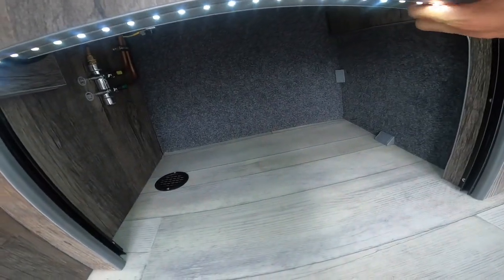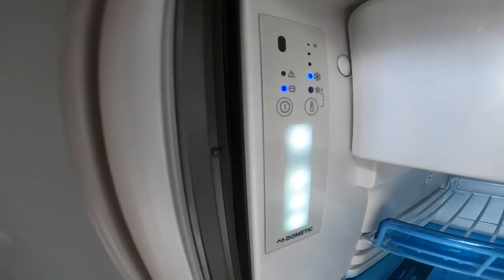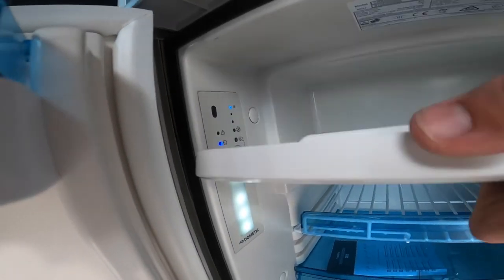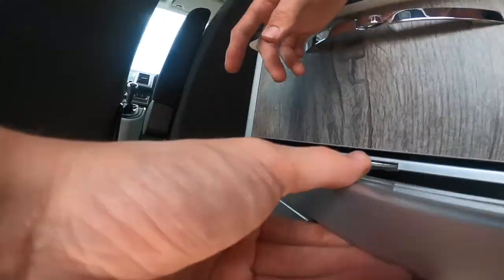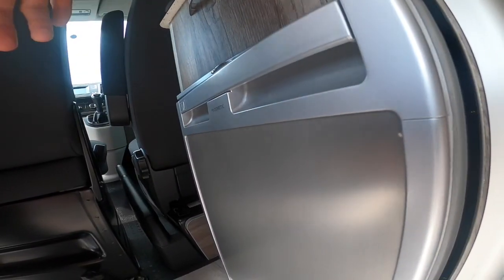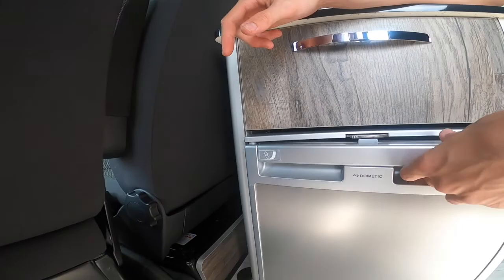You've got storage below your fridge. The fridge is a 12-volt compression fridge — turn it on and off by clicking and holding the button, then scroll through the temperatures. The bigger the dot gets, the colder the fridge gets, with a small freezer box. When you're not using the fridge there's a travel catch at the top so you can shut it. Put it on vent first, and you'll notice the door just clips in at the first clip and isn't 100% shut — that's designed to allow air in and out so the fridge won't go smelly or grow mould.